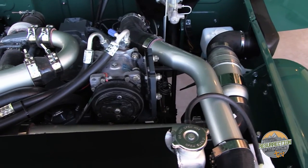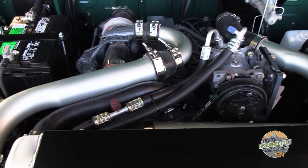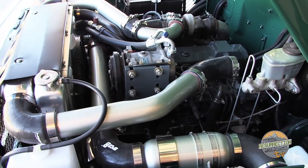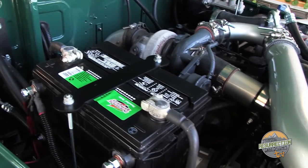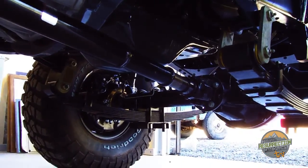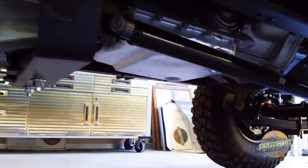We decided to keep the 3.3 liter Cummins diesel that we installed 18 years ago, but instead coupled it to a 4L60E overdrive automatic transmission. That makes this vehicle a lot more highway drivable. We added a robust cooling system with a big intercooler to get all the power we could out of the Cummins 3.3. The 4L60E is mated to a split transfer case with FJ40 e-brake provisions.